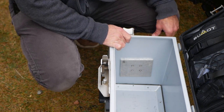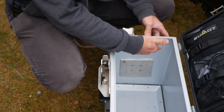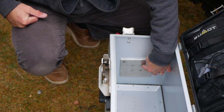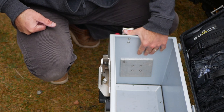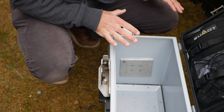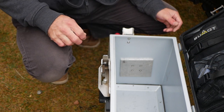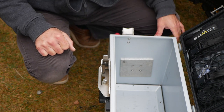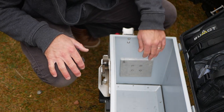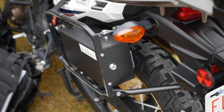I was asked how I mounted the jerry cans. These are inexpensive ones from AliExpress or Amazon — they come with a bracket. What I did was add an aluminum plate drilled in the same pattern as the mounting bracket to reinforce the surface. I'd recommend it because with bouncing on the road and liquid moving around — there's about three liters of fuel in there — the extra weight and vibration could bend the aluminum. The extra plate gives peace of mind without losing any room inside the pannier.